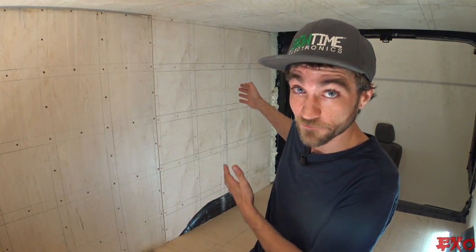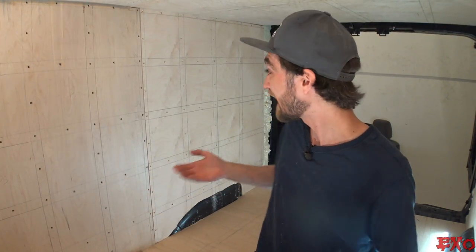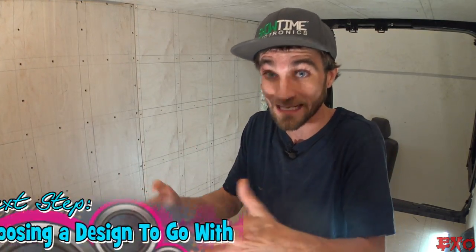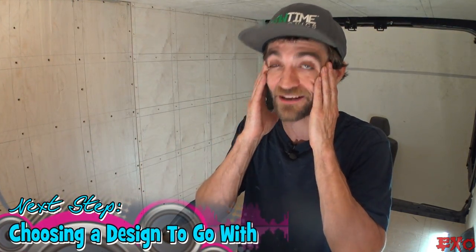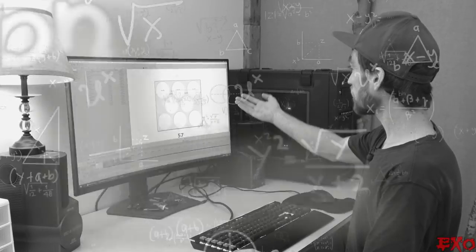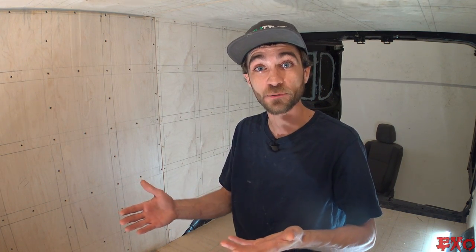So next up, I knew it was gonna be a super close fit for the baffle, but it gets really close. I'll go through all the math right now, because the next couple clips become a big time turning point. After all, pulling the trigger on the baffle means going forward with a particular design, and it's been really hard to choose. Behind the scenes, I've been crunching numbers on a crazy front firing sixth and fourth order, debated on a stack fab setup like that, but ultimately went with a sixth order for its real signature qualities.